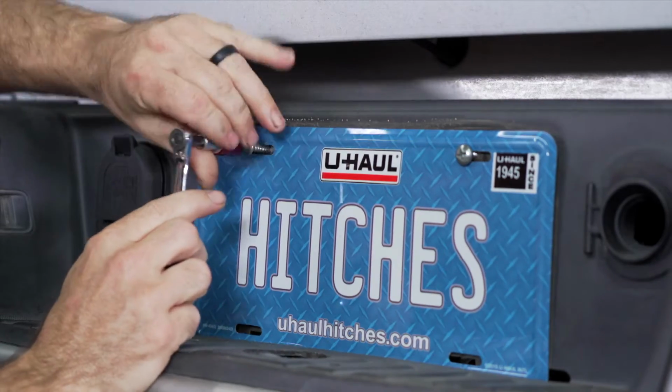For this installation, we are going to replace the factory step bumper with a receiver hitch. The directions call out that you can do this while the bumper is on, but we find it much easier to go ahead and remove the bumper, and you will as well. There are some electrical connectors in here we're going to go ahead and remove. Let's start there with our backup camera. It's actually right here behind the license plate.